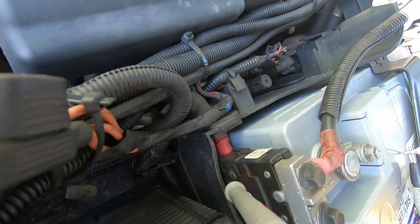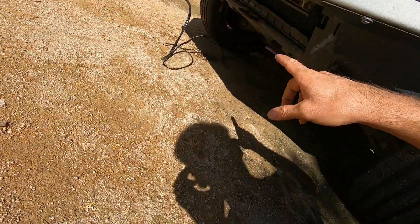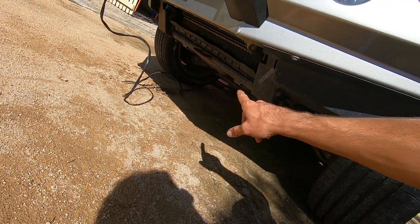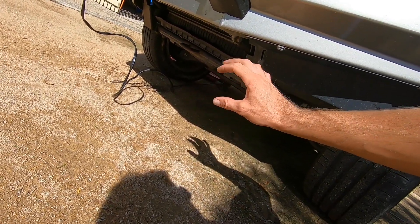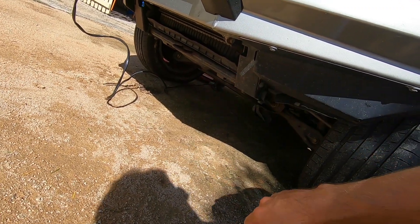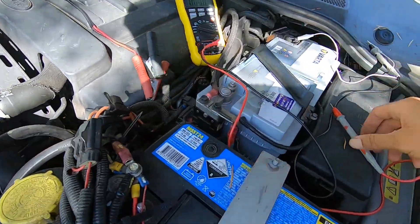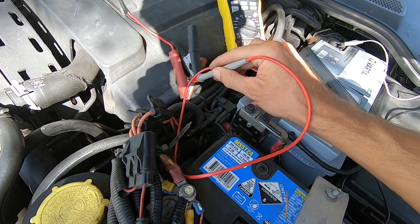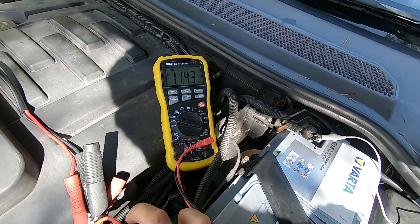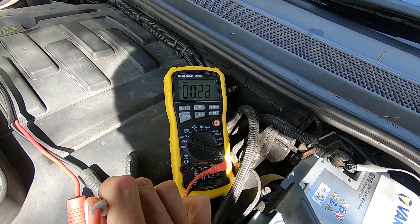What I've done now is I couldn't get a cable right on the alternator because access is terrible, but the power cable goes to the starter motor, which is where the cable then comes from the alternator and then on to the engine block itself — just round up here so I can check. We definitely have 12 volts but we also have no earth drop across the block between the engine and the battery.